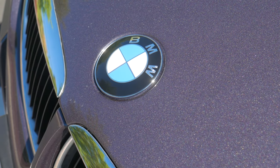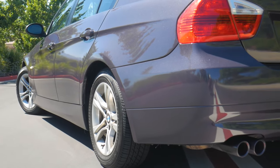The N51 was a SULEV — Super Ultra Low Emissions Vehicle — variant sold in states like California, Arizona, Delaware, Connecticut, and Maryland. Certain N52 variants were designated as the N51 because of SULEV requirements, since these states mandated that a certain number of vehicles had to be sold as SULEV cars to avoid hefty fines. The N51 is basically an N52, but BMW designated it separately due to its emissions purpose. Importantly, the N51 does have the three-stage intake manifold as well, though it's restricted by software tuning, which is why it only puts out around 225 horsepower.